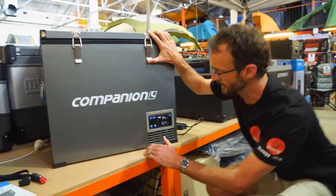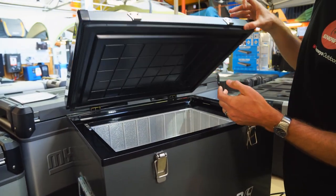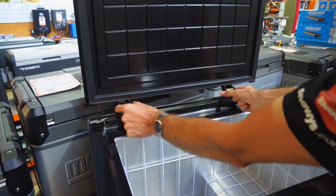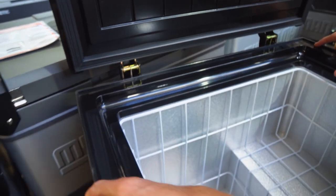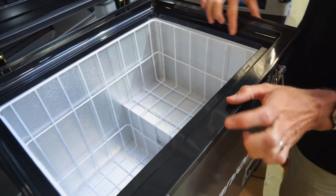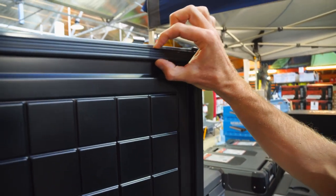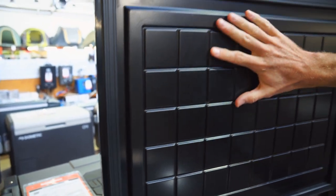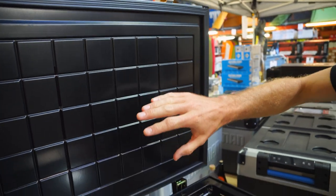Let's jump up over the top and have a look inside the fridge. This lid is sort of spring-loaded — they call it soft close — with an assisted open. There are metal hinges at the back covered by those plastic covers we saw. The insulation around here is about 6.5 centimetres of nice thick PU foam. There's also a nice thick seal that runs around the top to make sure the cold air is sealed inside, and the lid doesn't dip down inside too far so you can use most of the internal height.